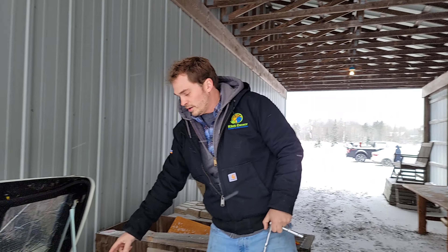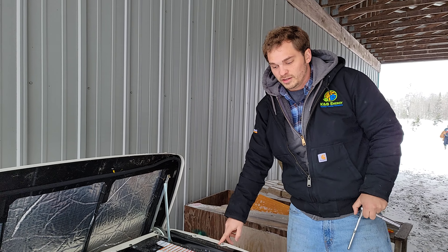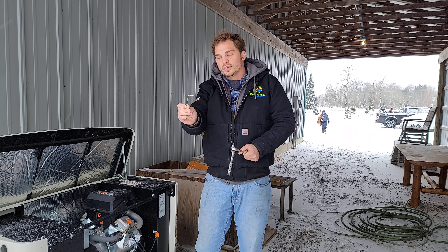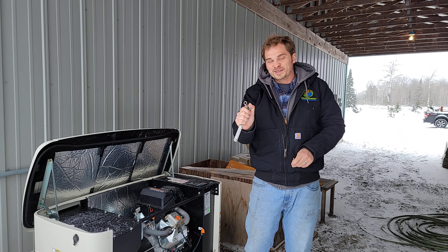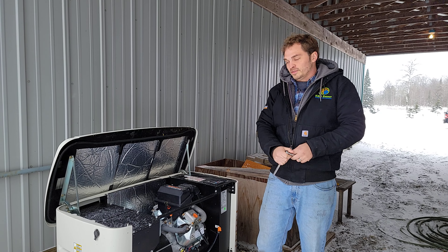To get there, there are three silver little screws — one here, here, and one down here. To take those off, we're going to need a couple different tools. Number one, an Allen wrench — find one that fits the screw holes. Next, you're going to need a 13 millimeter wrench for the battery post terminals.